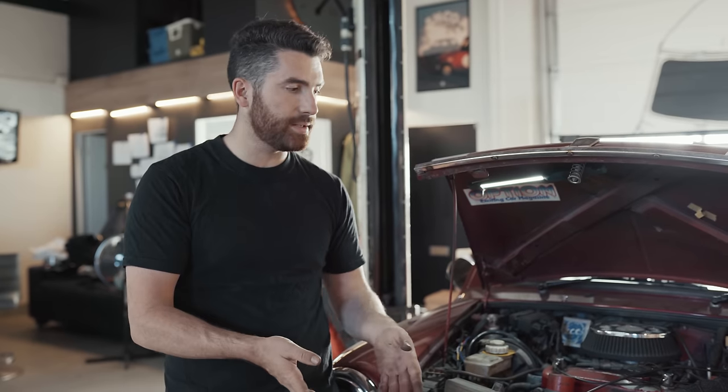What this does is, first of all, it gives you a different proportioning for the front and rear brakes, so you get a different volume of fluid being moved for the front system and the rear system. It also gives you a fail-safe. If one of the systems were to break a line and leak out, you have the other one because there are two pistons within that system.